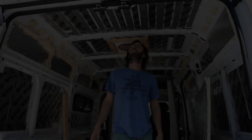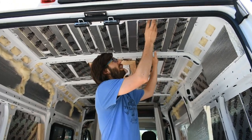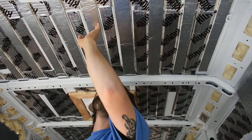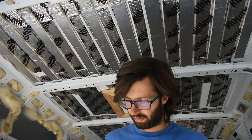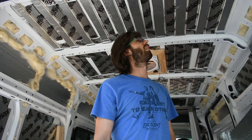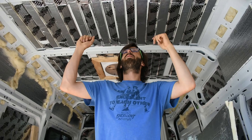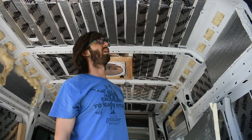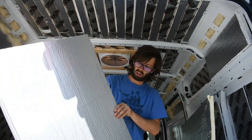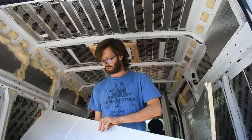For our ceiling insulation, what we're going to try on this back panel — I cut about two-inch strips of half-inch insulation board and put them in between the ribs. I just used a spray adhesive, the 3M 90 high strength. I used that and stuck these up here. Since they're so light, I just sprayed and pushed on them and they're stuck. Now that we've got almost an even surface, I'm going to put one big board of one-inch on top. So this was half inch, now I'm going to put one inch over top of that.